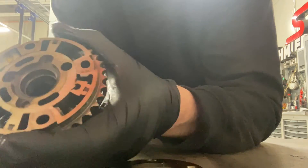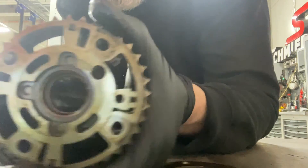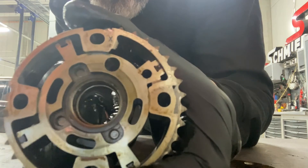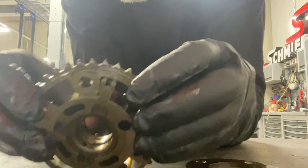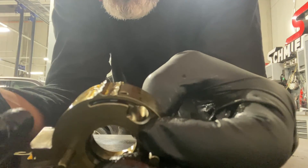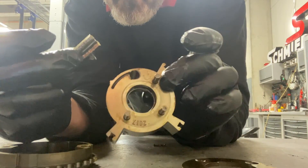After the initial jam and shear, it will intermittently jam because the broken piece moves independently of the inner part, as you can see it moving there. So if you've got a B48 or B38, that's absolutely what you need to look out for - and I've heard from friends who've had the same thing happen. That's why you use the oscilloscope: get a known good trace, and you'll see it sticking. Do a VANOS test on ISTA or whatever diagnostic tool you have - advance and retard it back and forth. Compare the traces and you'll spot it without even stripping it, so you can pre-order the VANOS wheels and bolts before disassembly.